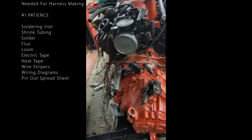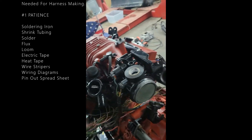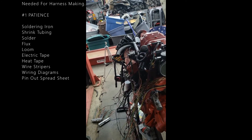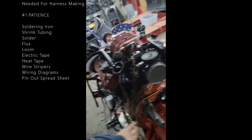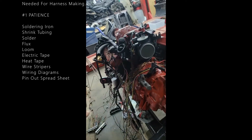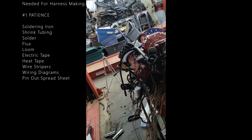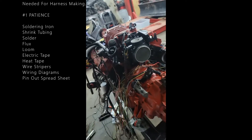I'm going to wrap the wiring harness where the exhaust goes. The harness will come up so it's not going under the exhaust. How I learned this is from my 3800 automatic — back in 2001 me and Tim ran the wires down, but there are headers there and they get really hot. So I'm going to run the wires up. There will have to be a starter wire and a few others going under there, but that junction right there gets really hot, so I'm moving the harness up and out of the way.